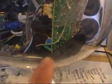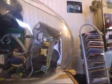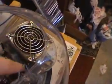So there's a power supply mounted at the back here. This is a naked power supply with its case taken off. Just the bottom piece is a bracket. That's actually the original case, just been trimmed and mounted sideways. And you'll see there's a plastic tubing ducting fan on top of it. The plastic is actually a juice bottle, but no one would know, and I just attacked it with a heat gun and a Dremel. Fit the right width, so it's nicely moulded for most of it. Just this back piece here has been melted in a bit, you can see it curves, tracks inward. That's to fit nicely and just draws air over that. So I'm running off a fan controller on the power supply. There's a TV tuner card at the bottom there.